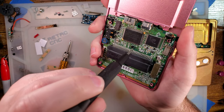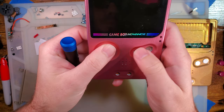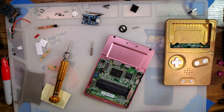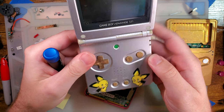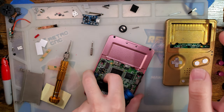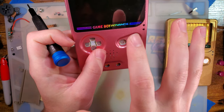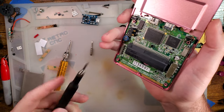A too-loose screw on the top will cause issues with both the D-pad and A and B — they won't feel right. With the stock plastic buttons, in some cases if this screw is not installed all the way, you can press the button down and turn it and it'll get jammed in there. And that is a problem with this screw in particular.